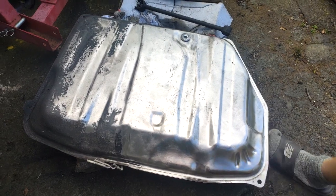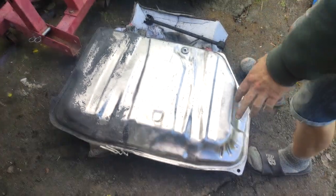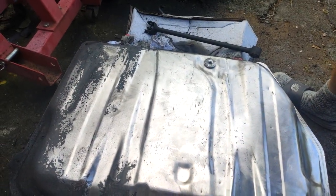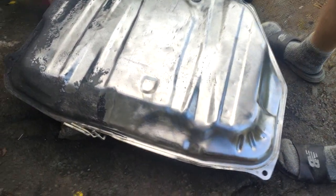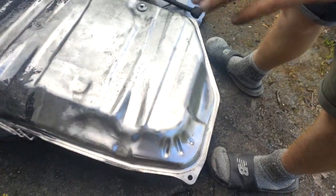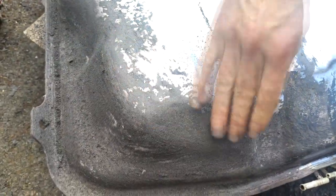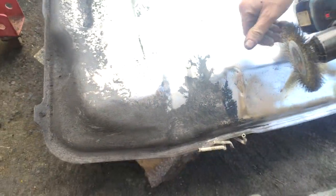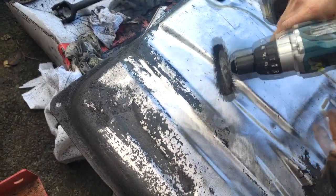Back here with the fuel tank. What we're doing is stripping it right back down to metal. I've tried my sander, I've tried a few different things — it's just not as quick. I put paint stripper on it. The reason I'm doing this is the guy who previously had it put some underbody throw paint on it and it's been all peeling. I put paint stripper on it and it hasn't come off, so I just have to hit it with this.